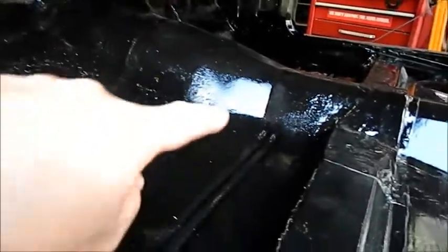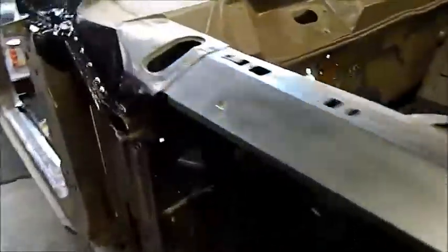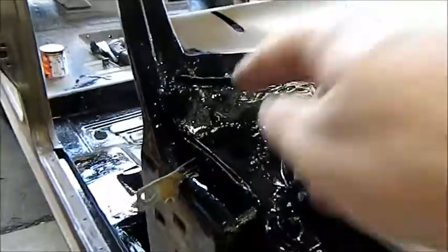Pain in the bottom. I've had to undo all this paint off around the edges and re-weld it. It's had to be seam welded all the way around because the plug welding wasn't enough. It's plug welded every inch or so, but it's also got welded all around the top as well now. Also done up in here — all up in there where it's been welded from the bottom, and these patches have all been welded in here now, so that's really really solid.